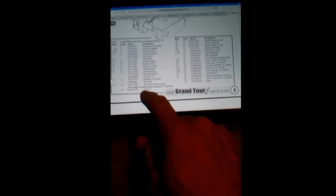Now, to tell you the truth, I couldn't get it figured out. So I went online, campersolutions.com, and got a link to my 2000 Grand Touring Series. And I'm looking at part number 13 to remove the extension tube. Look at 13. It's a 5/8 nut. 5/8. Fits right on. And I'm going to take that off. Hold the extension tube.